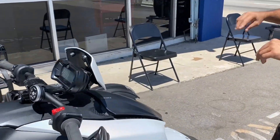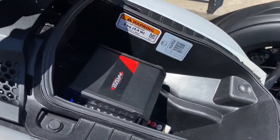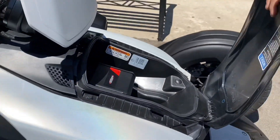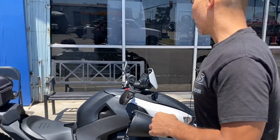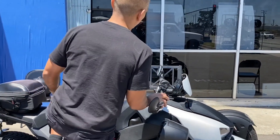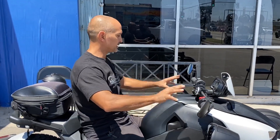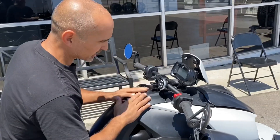For the amplifier, it's in the trunk here — we went with a Sound Digital. It's a 4-channel but we bridged it to 2-channel to get tons of power out of it. It's basically a 400-watt 4-channel, so bridged we're making it a 400-watt 2-channel, giving you 200 watts to each of these speakers.